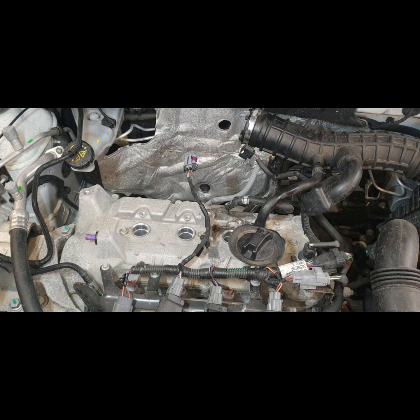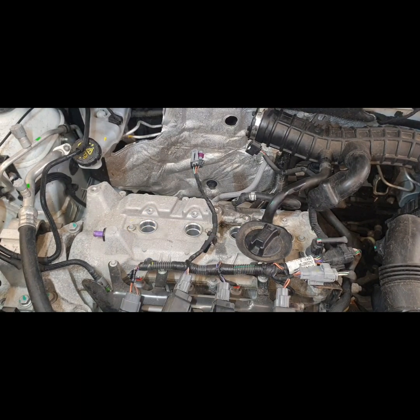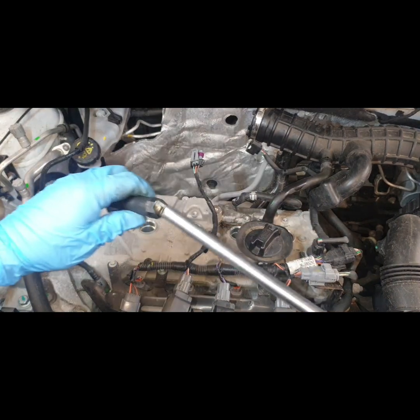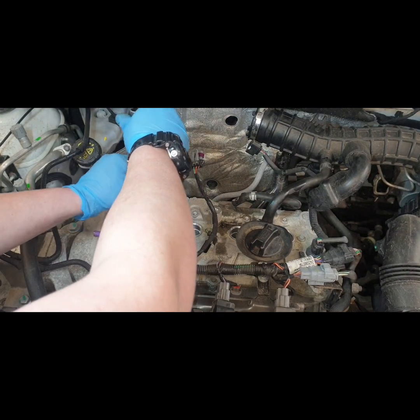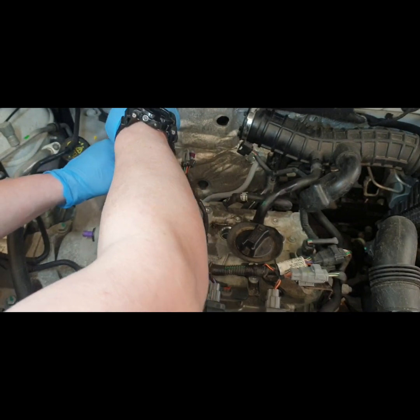This one has a bit of rubber, and both of them protect the ceramic. I've got my four new spark plugs and they're going back in. Put the spark plug into the socket, put it on the extension bar, and ease it down nice and easy — start it by hand right up until you can't tighten it any more.